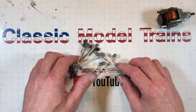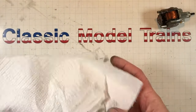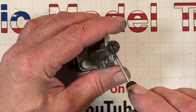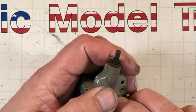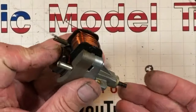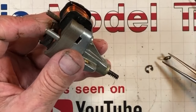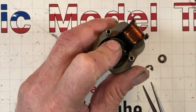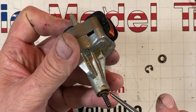Let's get back into fixing the 671 and see how nice it looks. The Q-tip pile doesn't look too bad so far — some of it's quite carbony. Let's just pop this C-clip out right here. It is hiding right up in the nose of this thing. There should be a washer — and here's our bearings, and they are in a keeper. So it looks like that information I found is good. We can now pull this out.